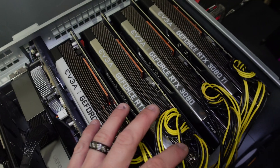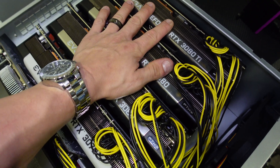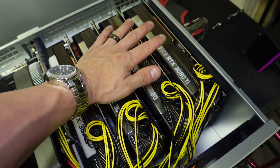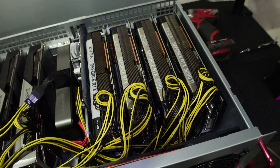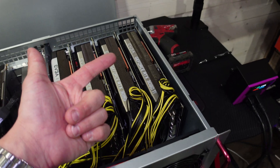Let's dive right into it. We all know that these cards have had heat issues — pretty much everybody that owns one has a heat issue with it. So we need to either re-pad, repaste, or change something else.